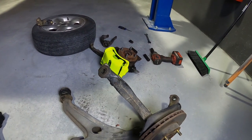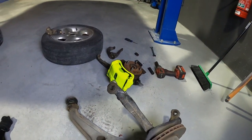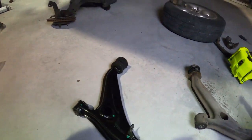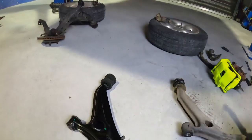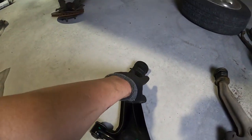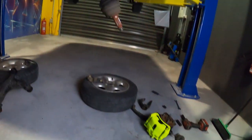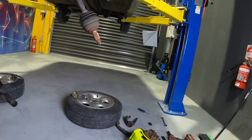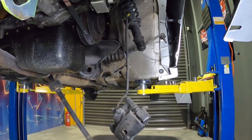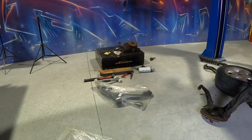But finally, we'll be able to do the brakes. So I've test fitted those onto the uprights and they fit. So I'm going to put all this back in the car now. Just a matter of pulling out this 19mm bolt, and then there's 3 19mm bolts holding the back end of that together. And then you've got to take out the drive shaft nut, undo the brake caliper and all that sort of stuff. So we're going to put these back up in the car, take out that janky suspension and put in the new Max Speeding Rods, which are over there in the box.